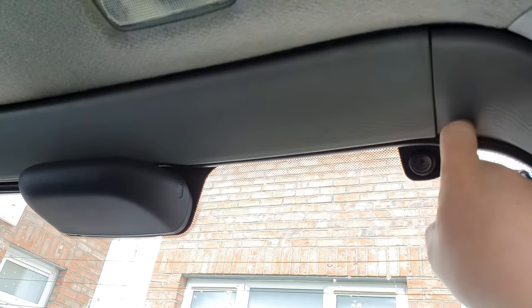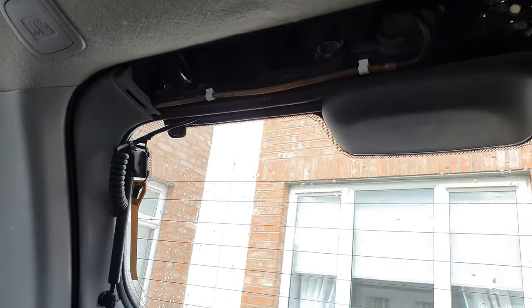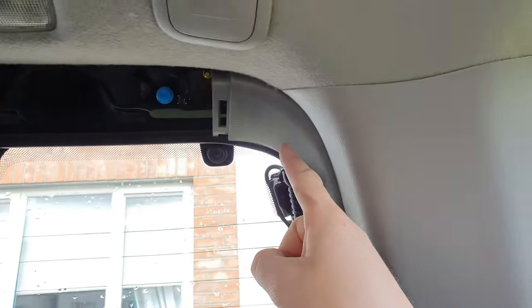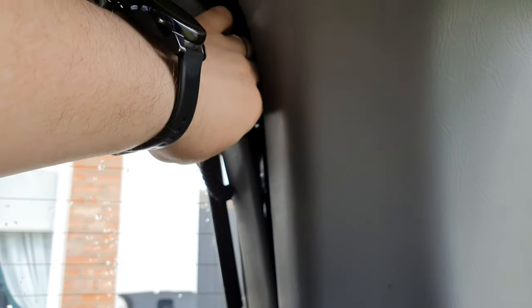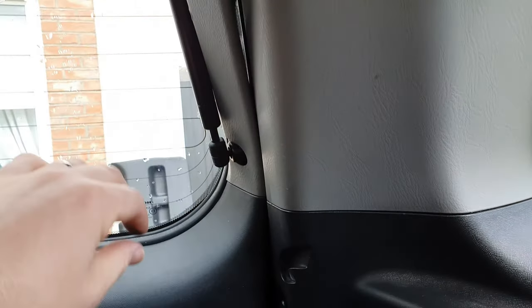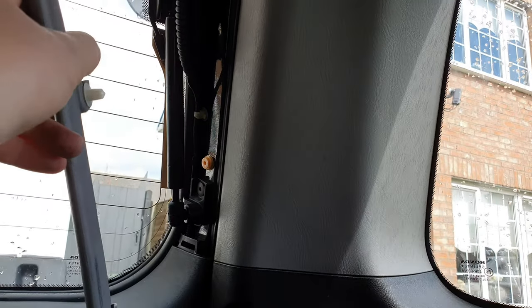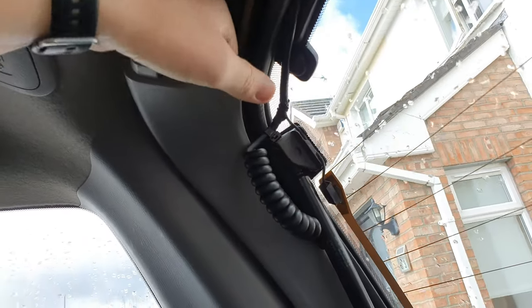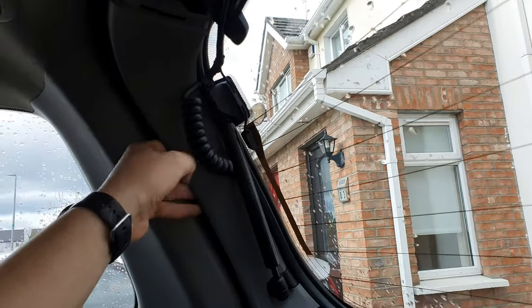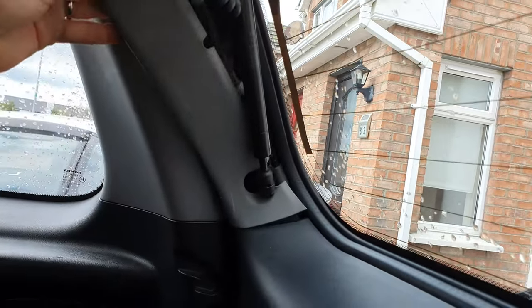Pull all of this rubber out of the way and just get your fingers in and pull it out straight. There are four clips on it and it should just come off. Once you have this one off it's a lot easier to get the others off. Now you can see what's holding it on — there's just an orange clip there and a white clip up there. They just pull outwards, and the same on the other side — just pull from that corner and then down where the other clip is.